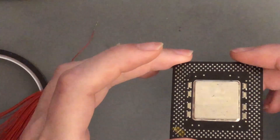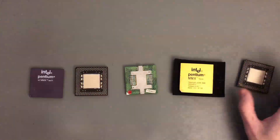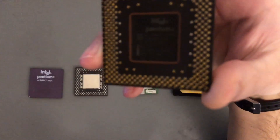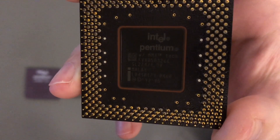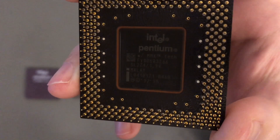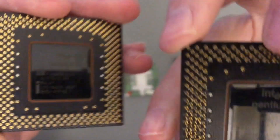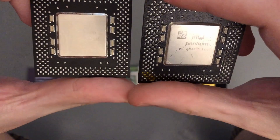You might want to cover everything with some isolation tape, but in the end this is not necessary. If you use this very thin wire, all these connections sit lower than the capacitors, so there's no way to short them by placing a cooler. Going with this common chip and doing these modifications is I think the best option. Here you can see this is a 266 chip with code SL2Z4. Comparing this chip with the original Pentium MMX, on the front side there is no difference at all.